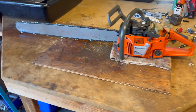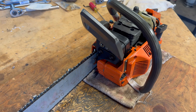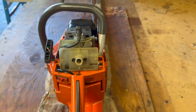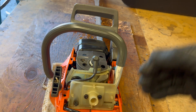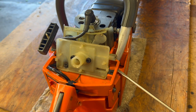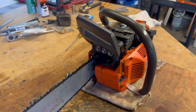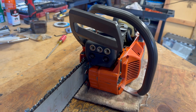I'm pretty happy with this. Obviously it's got a huge chain and huge bar, so it's accelerating all that mass, so it doesn't snap super hard — but it's easy to start and it snaps pretty good. I've got it four-stroking, just before it goes screaming. I've also tuned it so when I let off the trigger, it reliably comes back down to idle without almost dying and coming back up. Getting all that right has also let me turn down the idle to a fairly low speed, so it's not super loud. I'd say it's maybe 25% louder than stock, and not as loud as some bigger saws I use — noise has increased, but not in any way that would be a problem.